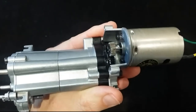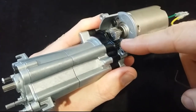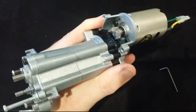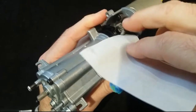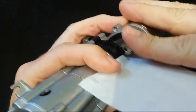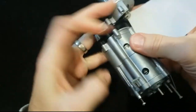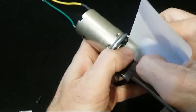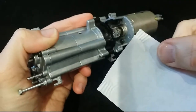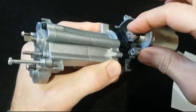Next major thing that's very important is to get the mesh right. A good rule of thumb if you're new to this: you can get a little bit of paper and put it in between here. If the paper can go in between there, then generally it's good mesh. The paper can still travel through there - it's got a good mesh. And if you've been around the hobby for a while, you just know that it's not binding, it's nice and free.